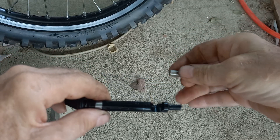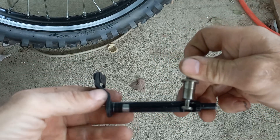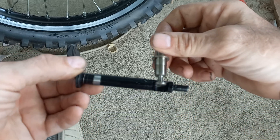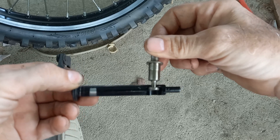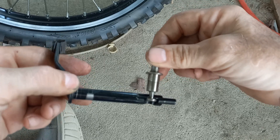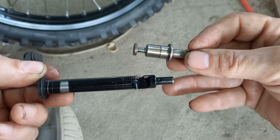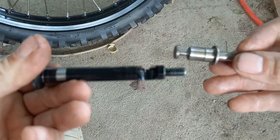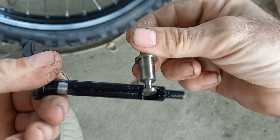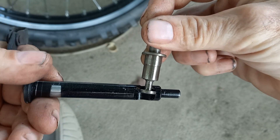Basically this is the opposite of a push rod — this is like a pull rod. It fits in there like that. The clutch arm comes this way and pulls the rod that way. Everything else seems to check out all right, apart from this pull rod doesn't fit. There we go — you can kind of see how that pulls your clutch in and out to release it.